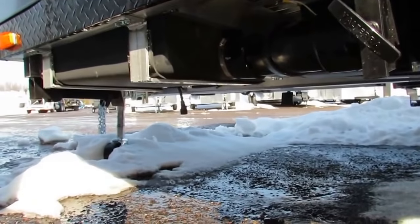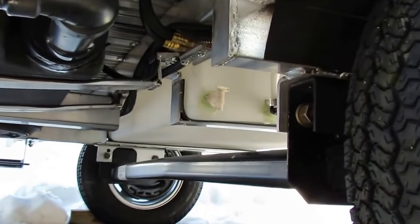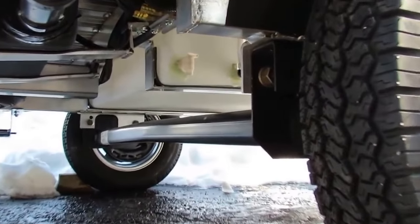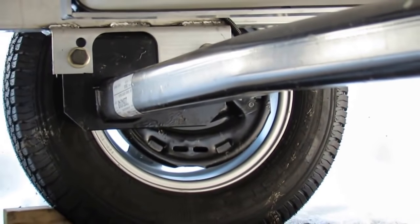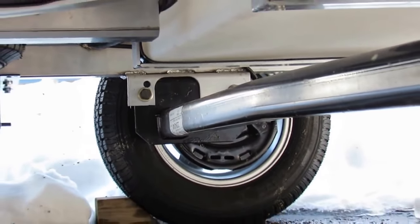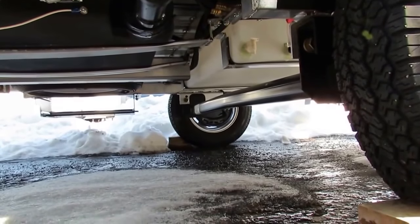While we're underneath, we're going to look at the holding tank for your black water mounted on the front. Your fresh water is just above the axle underneath the trailer — most trailers will have them inside, but this one's underneath outside. We are running a torsion axle; there's no leaf spring suspension. As you can see, it's one complete axle, but it is mechanically fastened and protected onto the aluminum bracket, and this allows for independent wheel suspension. So you're not going to have the trailer bouncing back and forth like you would find on a lot of small travel trailers or utility trailers.